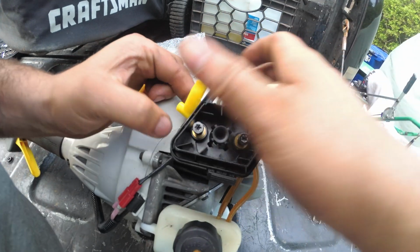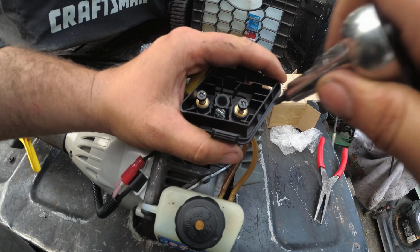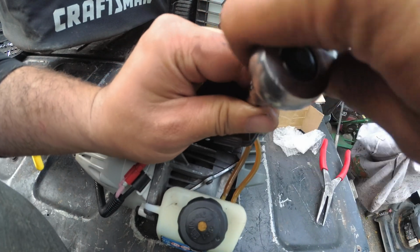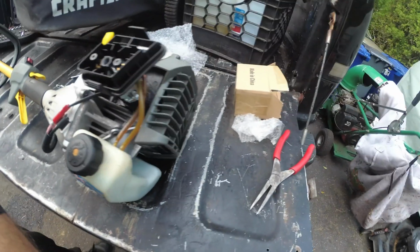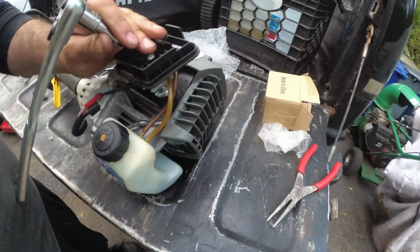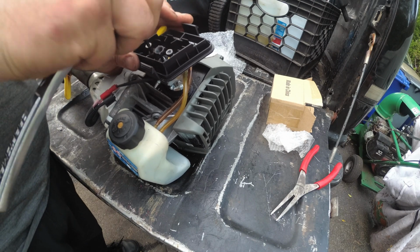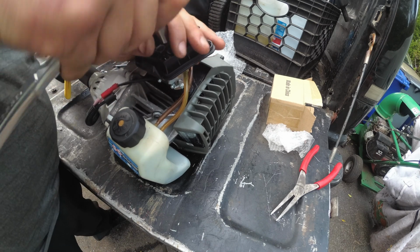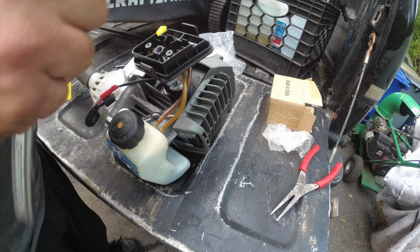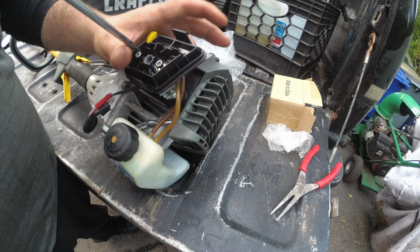So if you guys want to know, Mower Madness was a complete failure. Forgot my puller to swap engines. The Tecumseh that needed that, you guys watched the video, the Craftsman. While I was working on another machine, I had that thing running outside to warm up the oil so I could change it. You want to guess what happened? The O-ring on the dipstick failed. You take a guess. The engine ran low in oil, and a bunch of smoke came out.